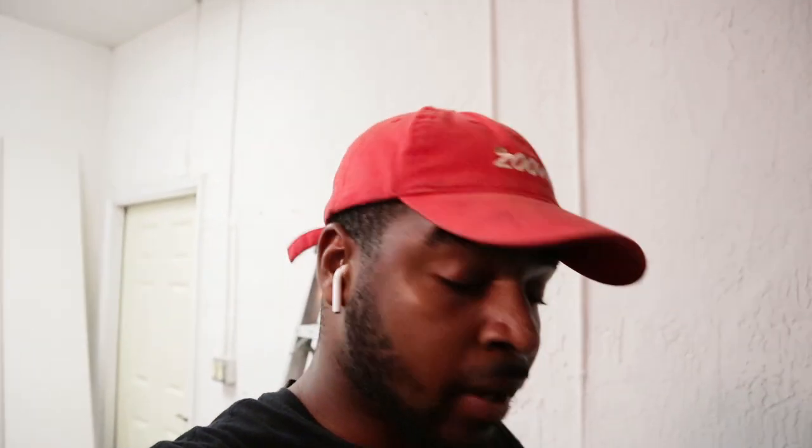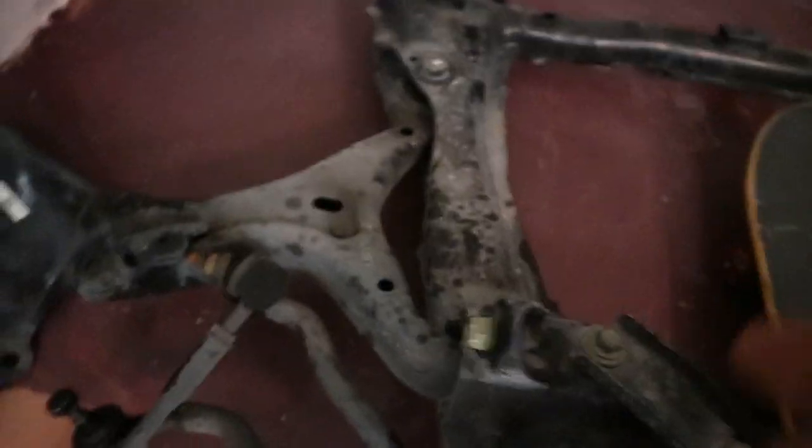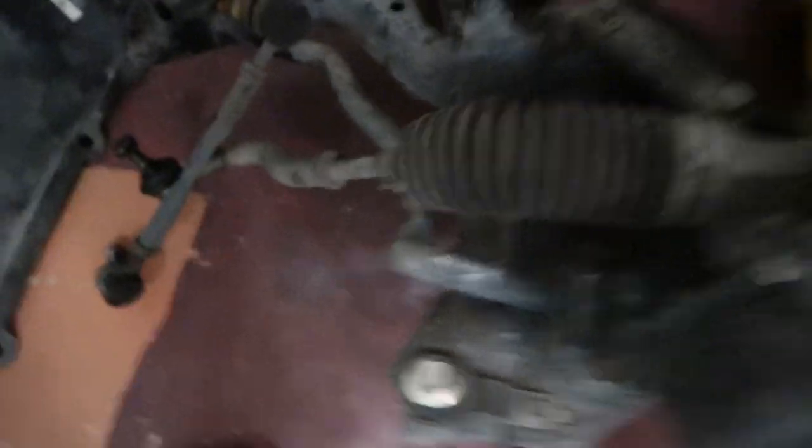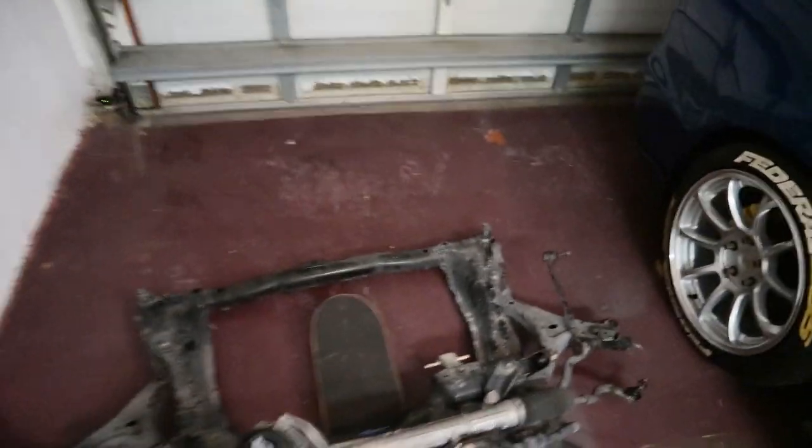The subframe is out — it wasn't as hard as I thought, pretty easy. I used two jacks and a skateboard. If you have rollers they'll make it super easy. Lower one side slowly then the other. By the way, I told you guys the wrong bolts earlier — you're going to remove the two in the back which is correct, but the front ones are actually in front of the steering rack behind a cover. Bend that cover down and you'll find those bolts — they're 17s.